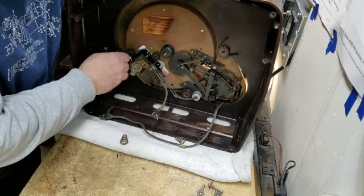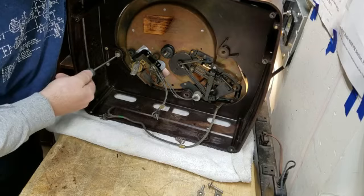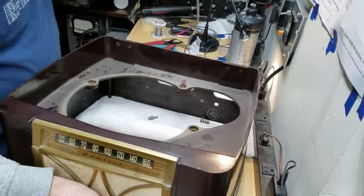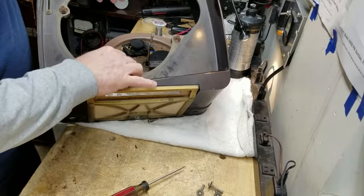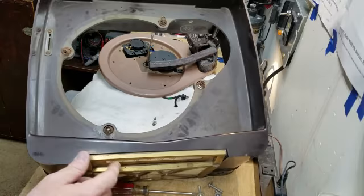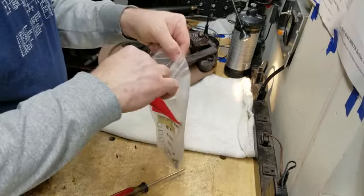I guess there are four of these — I counted wrong. And there are, up above these screws straddling them, some springs. These springs sit on the record player and nestle in these little wells in the base of the cabinet. These springs seat in these little wells with the narrow side facing up toward the underside of the record changer. So we have four screws, four thick fender washers, and four tapered springs — all go together with this Admiral.